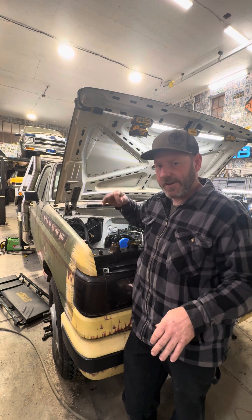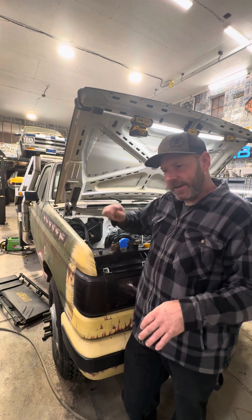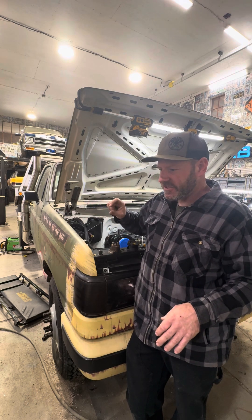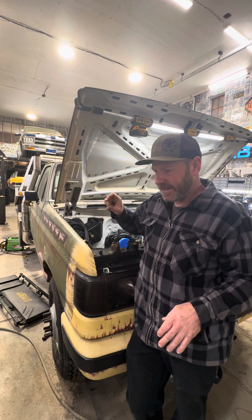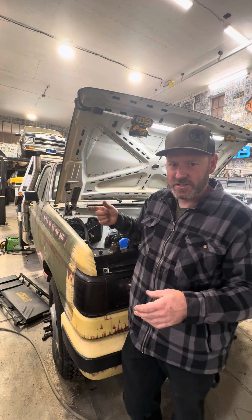This video, all I'm trying to do is run a fuel pump while cranking. And I don't want to backfeed and make my starter go when I turn my ignition on. So I don't want to have a relay there just for that function, because it would just be going to another relay that was going to the fuel pump — so I'd have two relays just to do one function.